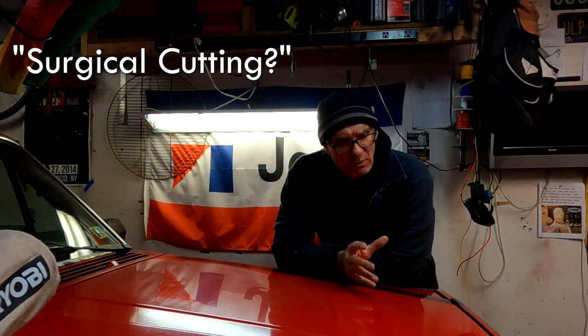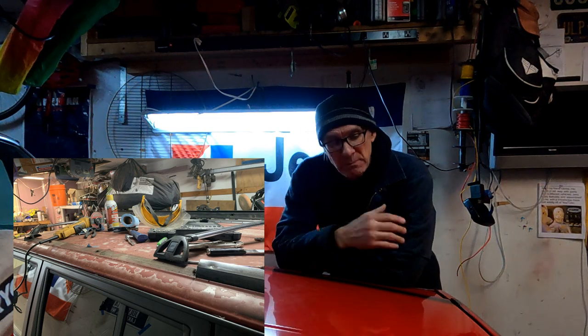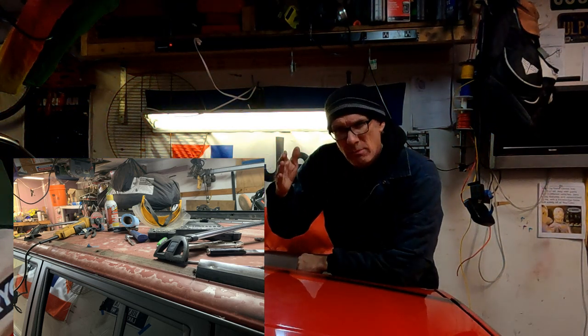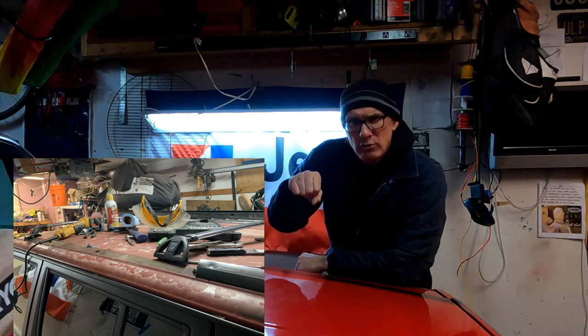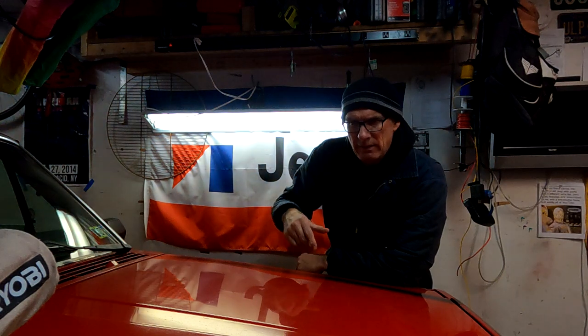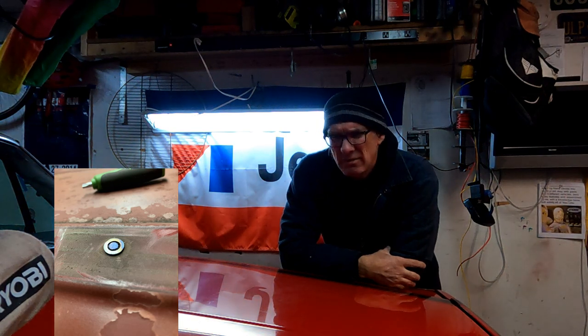With some careful, surgical cutting with my cutoff wheel, I've gotten really artistic with that thing. I was able to cut it in half, right before the bolts, and twist it back and forth. It's aluminum, so it broke right off. And then with the grinding wheel, just grind down the heads of the bolts and push through the nut certs. I think they're like 3/8 nut certs.